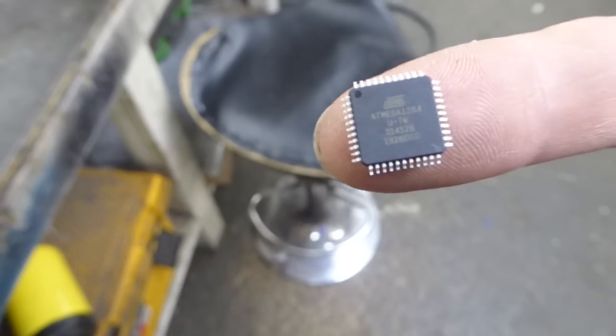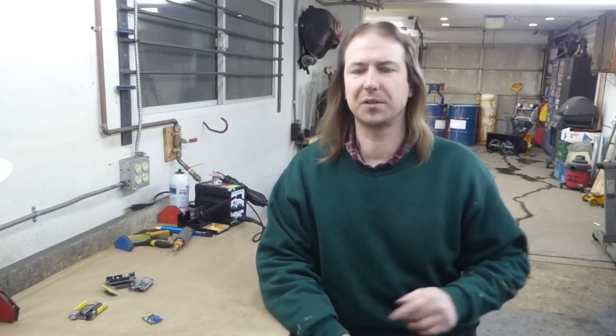So what I've decided to do is use this. The Atmel Atmega 1284. The 1284 is kind of an overlooked processor in the Atmega line that I've used in several projects. It's quite capable, and in a small package. 128K of flash memory, 4K of EEPROM, 16K RAM, 32 general purpose I/O lines, 2 UARTs, I2C, SPI, and a bunch of other stuff. Easily enough power to run all those screens, stepper motors, and CAN interface.